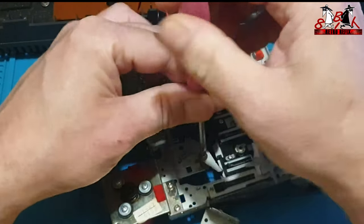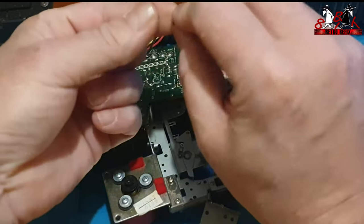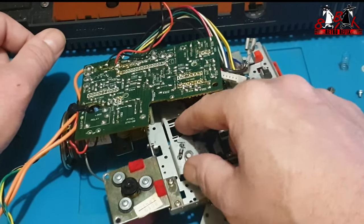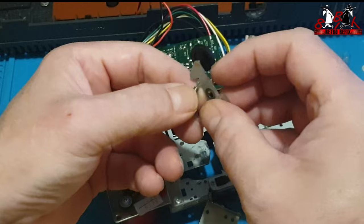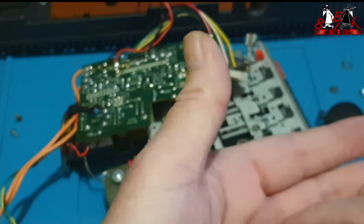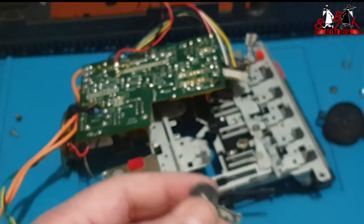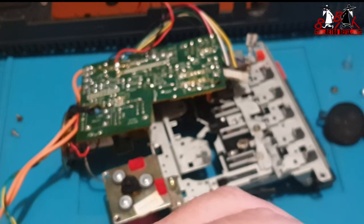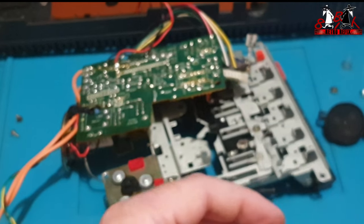So we'll go for that screw first - that's the idler screw, it has got a little shoulder on it so you can't over-tighten it. We'll just try and unhook that off there - it's come off really easy. This is the little pulley that's giving us all the grief, so be careful not to lose that spring. All I'm going to do is pull that out of that hole - it does feel a little bit greasy to be honest. That rubber is off there.